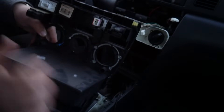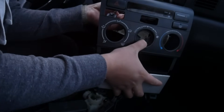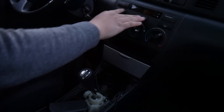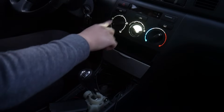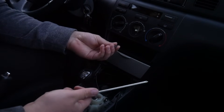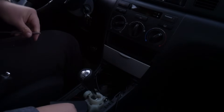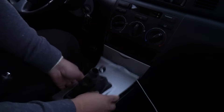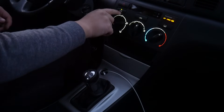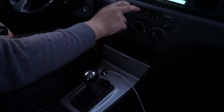Go ahead and plug everything back together: defroster plugged back in, airbag plugged in, clock plugged in — which doesn't work but hasn't been working in this car for a while — and flasher plugged in. Clip it back into place and do a final check to make sure everything works. All buttons are looking super nice. Put all the screws back, throw the dial back in, that's screws one, two, and three. Throw the shift boot over it, clip it back, shift knob goes back on, and it's done. AC works, defroster works — everything's working. Well, except the clock.